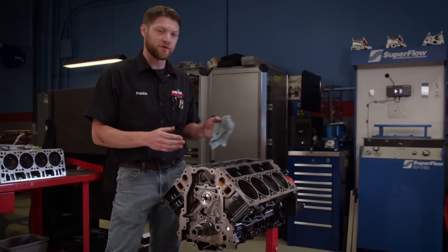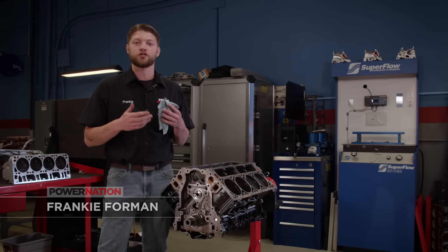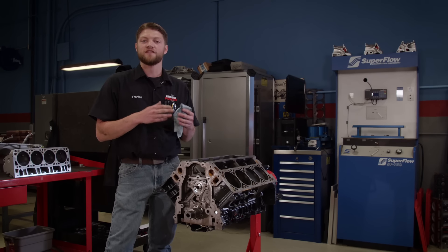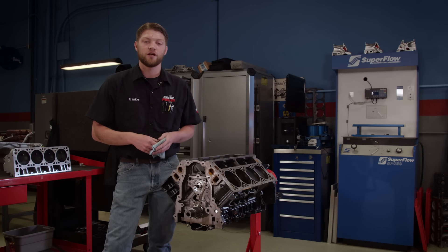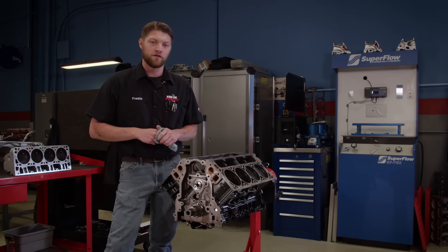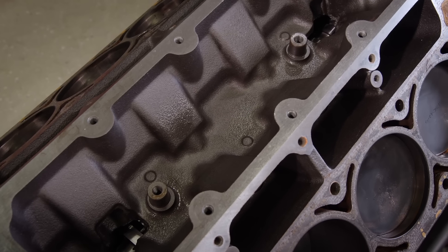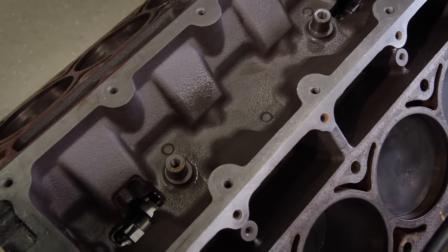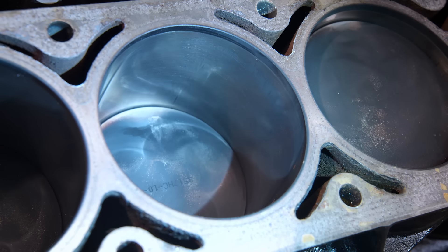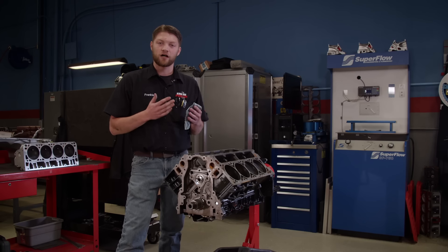Looking at this engine from a distance, it's pretty clear that it's a used engine. But if you start looking closer, it's actually extremely clean, and the reason for that is that this is a remanufactured engine. With a lot of these LS-powered cars getting up there in age, it's going to be really common to find rebuilt or remanufactured engines. As we were tearing this down, this engine has very minimal wear and is very clean. There's not a lot of sludge in the oil pan or in the crankcase. The cylinder wall finish looks excellent, and it's already been oversized 40 thousandths — or one millimeter — over the stock four-inch bore.